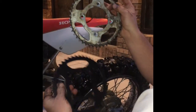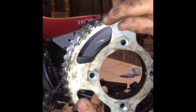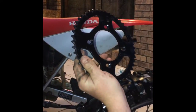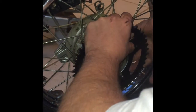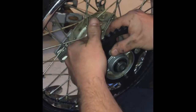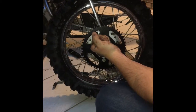This one has a lot of wear — this is the rear sprocket. You can compare: this is scalloped out, and the teeth are real thin compared to the new one. This is the direction it turned, so it was pulling and scalping out here. We're going to put the new one on. It has a 14-millimeter nut on the back side and a 6-millimeter Allen wrench on the front side. This is the last of the four bolts we have to tighten for the rear sprocket, and we're fixing to put the wheel back on.